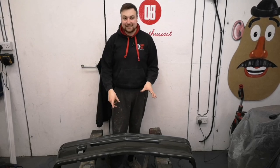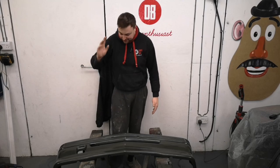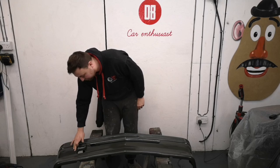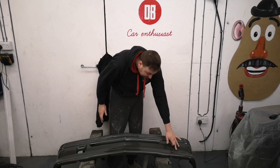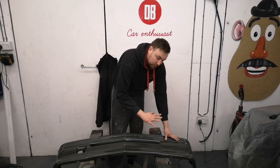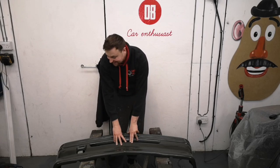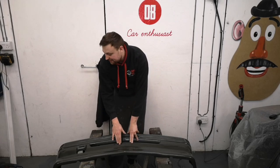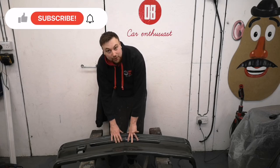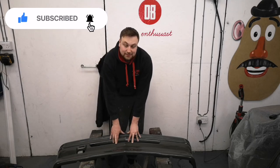Welcome back YouTube. In my last episode I sprayed the underside of the car and the front bumper. I did the bumper outside and it actually rained as I was doing it, so I've got a few water droplets in the paint. This was on the second or third coat, so in theory I should be able to sand it back and polish it up. However, because it's got a satin agent in the direct gloss, if I did that it would make the paint go glossy. So it leaves me with only one option: sand it down again and re-spray it. That's what I'm going to be doing today.